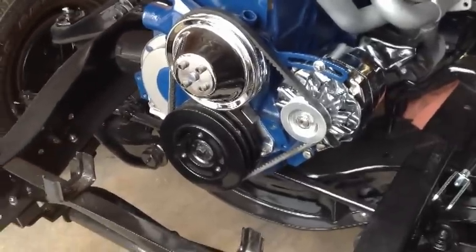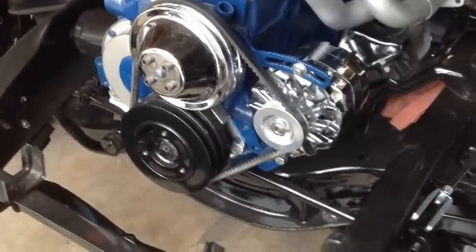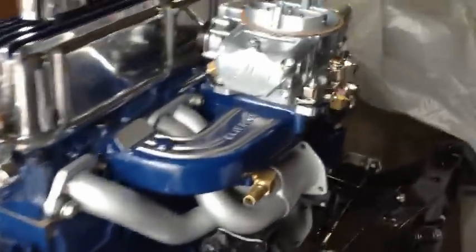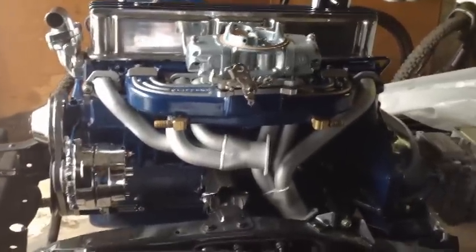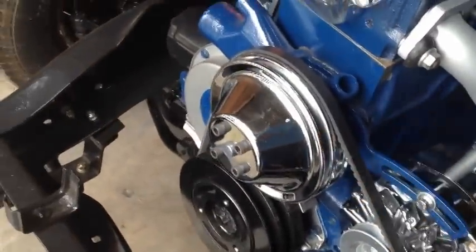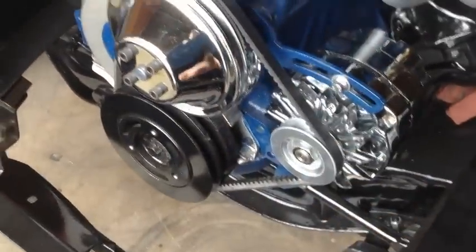Today's Monday and didn't get a whole lot done this weekend because it snowed again. Temperatures have been way down and it's just been too cold to really do any painting. So I've been fiddling around with getting this motor ready for its first startup. The plan is to have it running by May, which so far is looking really good. Finally got a shorter fan belt — had to get one that was an inch shorter because the other one was too long since I went to a smaller pulley.